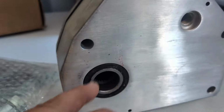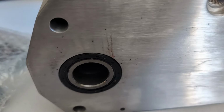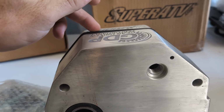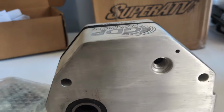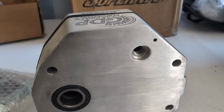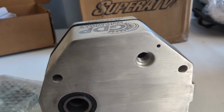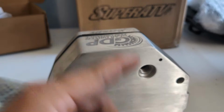Every portal I rebuild, these seals are just packed with mud and dirt, and it's very obvious that that's where the water's getting in. Either the water's getting in through this top inside seal, or it's getting in through the gasket because the gasket's blown out like that. We're actually going to open up this box and take a look at this gasket from the inside, which you shouldn't really have to do, but almost every portal I do, I have to open them up when I install them. Either install new gaskets, make some custom cut gaskets, or just open them up and adjust the gaskets. Gaskets are a real pain. That's the biggest benefit for me for an 8-inch portal, is it has an O-ring instead of a gasket.